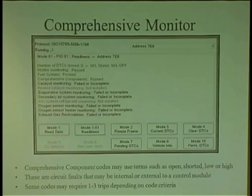And we know about comprehensive monitors. In OBD II systems, just like any other computer, comprehensive means it's the touchy, feely. It's going to check any component that's unplugged on the vehicle. And the best way to do it is 3 key startups. Because you could probably clear the code and start and go, oh, it didn't come back. Yes. Just had to clear it. Now you wait a minute, start again, light comes on. Because it was a 2-trip check. It could be a 3-trip check.